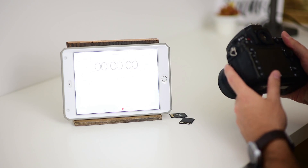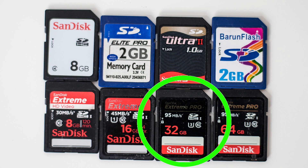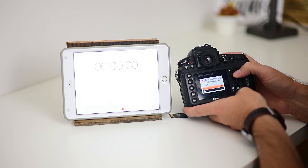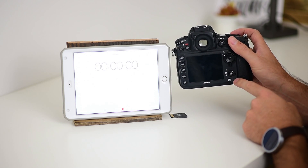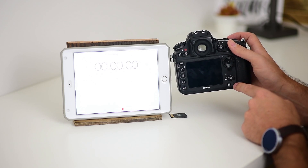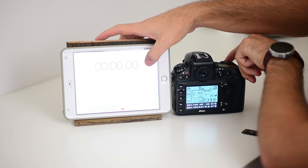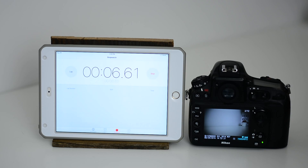I'm going to show you in a very practical way what the memory card difference is. I have a 32 GB card here — the size doesn't matter, but it's 95 MB per second. I'm going to format it and then shoot 12 pictures. This little green light shows when something is being written to or taken off a memory card. I'm going to take 12 pictures and see how long it takes to write to the card. Ready, set, go. As soon as that light turns off, it's done — it's written to it.